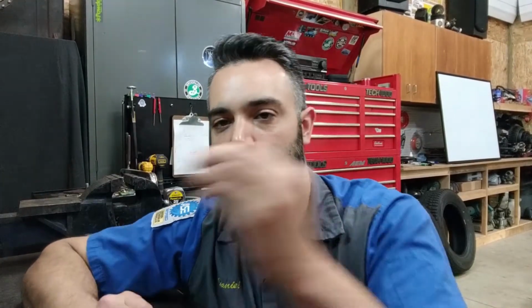As the fluid becomes aerated, those air pockets are going to be obliterated and emulsified into the fluid. That emulsification is going to aerate the fluid, and it'll look kind of foamy or pink. It'll have a foamy characteristic to it. Once the fluid becomes aerated, and that just means once that air pocket has passed through the pump itself, and you hear that little noise, that means your fluid is now aerated, and you have to shut the vehicle off, let those tiny air pockets and air bubbles rise out of the fluid, start, stop, and repeat until all the air is mitigated from the system, and keep topping off the system with the correct fluid.